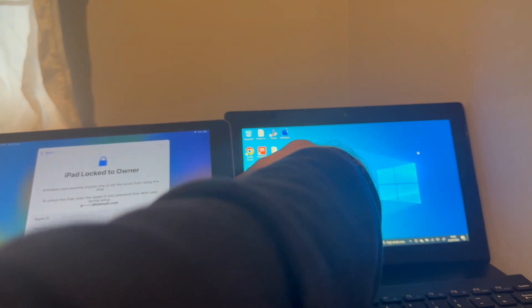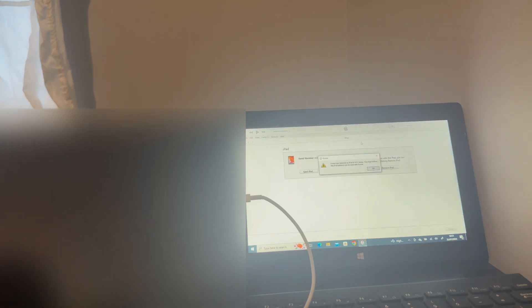First thing to do: put your device into DFU mode. Hold the power key and the home button. As soon as the screen goes black, one, two, three — let go of the power button, keep hold of the home button — three, four, five, six, seven, eight — bingo, it is now officially in DFU mode. Make sure you close iTunes while this is happening.